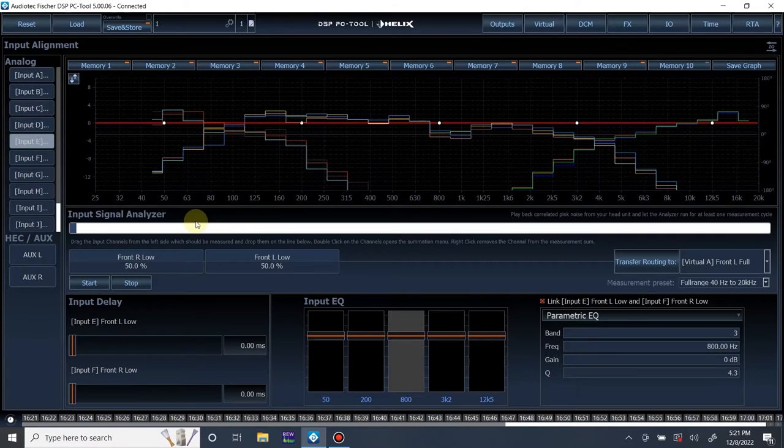I'll pause that. So it looks like, like I said, no timing differences, no phase differences. I think I see maybe a little tiny one up here, but that wouldn't make sense. It's so far out of its frequency range. So we have no real timing differences from right mid bass to left mid bass, right mid range to left mid range, and right tweeter to left tweeter. They are in time, in phase, no all pass filters, no weird wonkiness, no up mixers or anything, based off of earlier testing that is not in this video.